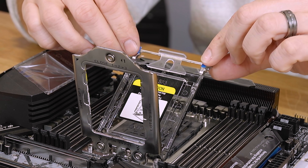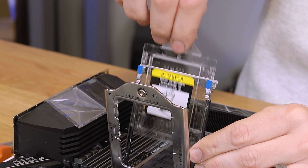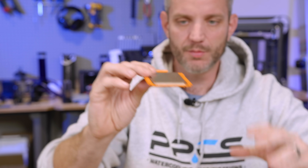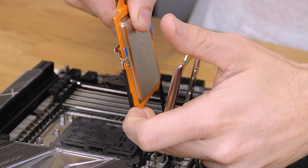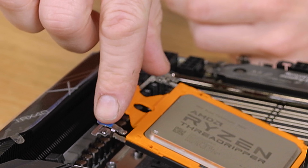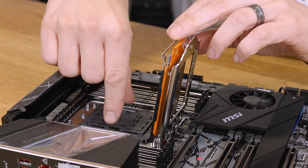These two blue pins cause the metal bracket — which is also spring-loaded — to latch down onto the motherboard. Pull those up and you'll see a clear plastic tray. When putting the CPU inside the retention bracket, you'll notice rails on the side that match the clear tray you removed. Make sure the CPU is inside the actual rail and not popping out. It should slide down smoothly and click in at the bottom. Push down on the blue tabs — not on the CPU — or it can pop out of its orange bracket. Before doing that, remove the actual socket cover protecting all the pins.